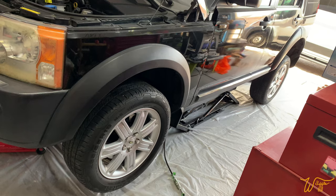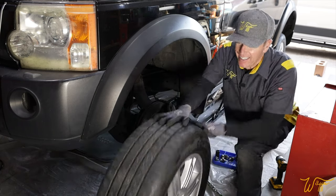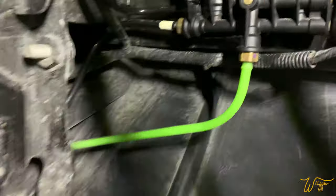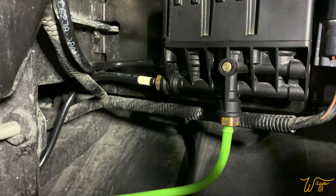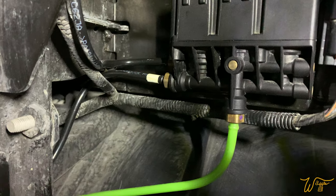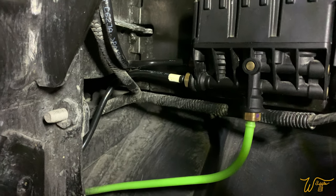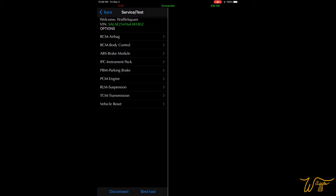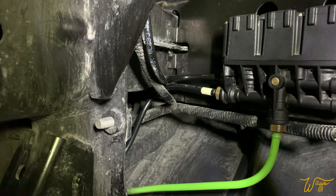Back up on the quick jack. I'm not a mechanic — I just dress like one on YouTube, so you're coming along for the ride to see how I'm doing it. Let's first talk about safety. Right between the wheel well and the front passenger side is the valve block. We want to relieve the pressure from both struts we're changing out. There are two ways to do that: number one, come to the valve block and loosen the green one on the bottom and the black one on the top to relieve any pressure. Or, go to the GAP tool, go to service test, suspension, and then deflate all — or you can deflate certain sides — so you know you're not going to be blasted in the face.